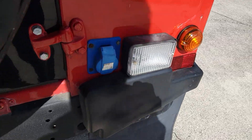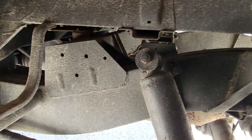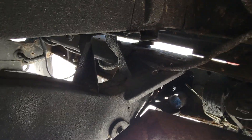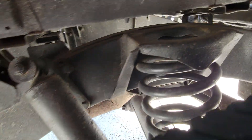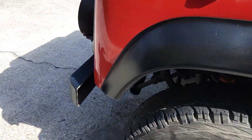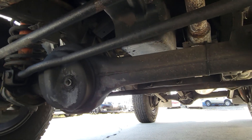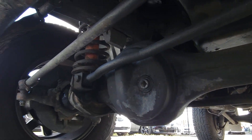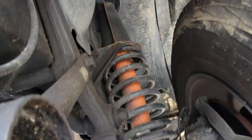It's got a tinted glass black roof with a little ladder, and it does have a hitch — a European-style hitch — and a trailer connection. As far as what this car looks like underneath, it looks extremely well. These cars usually don't rust a lot, but the sensitive area is right there at the end of the frame rail — that's where we see them rust. If you look at the springs, it looks like it has newer suspension components; even the bushings are urethane bushings. There was definitely work done to this car. The front is dry — it doesn't leak anything.